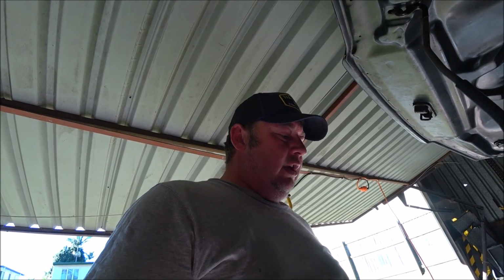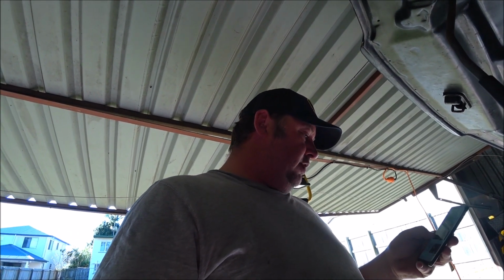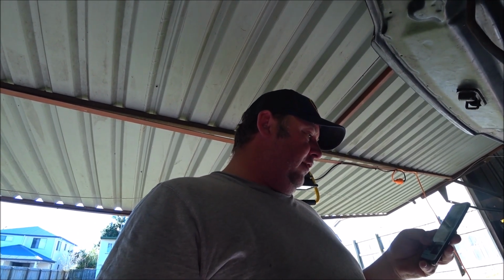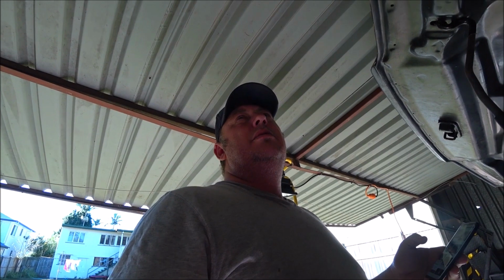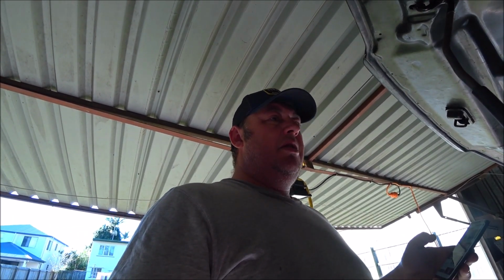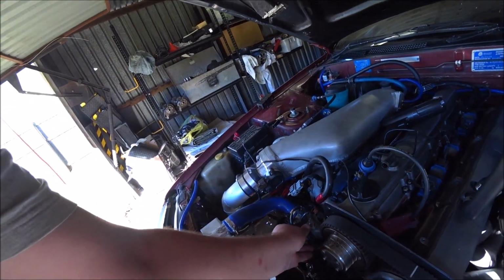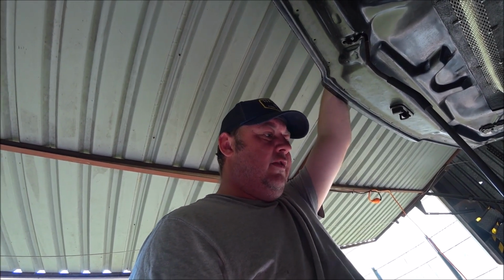Now the result is a bit funny. It's jumping around a little bit, and I'm just double checking the timing marks. I'm pretty sure they're 5 degrees every mark. The first mark is 0, but that's something I just want to double check. If that's right, then it's going between about 12 and 15 degrees. So the timing's moving. I assume that's a bad thing, if that's inconsistent. Now whether that's the CAS itself or if it's maybe just a plug, not sure. But the upshot is that it's too far advanced.